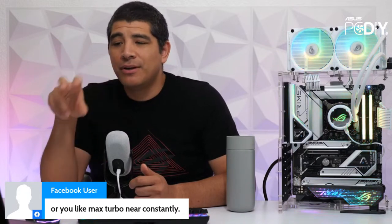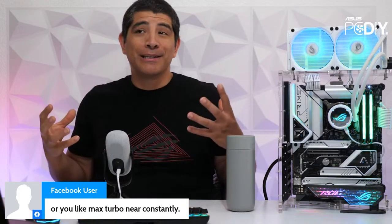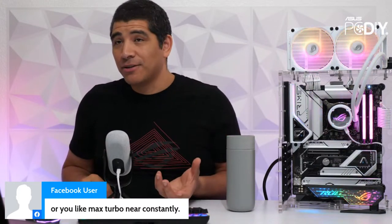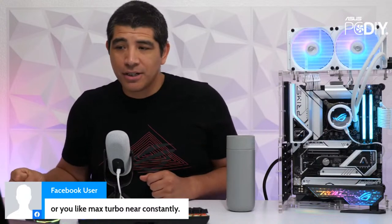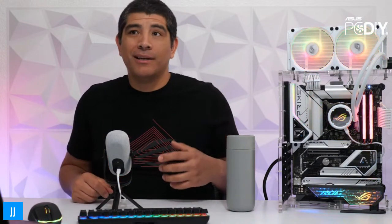So when you say something like max turbo constantly, what are you really talking about? Are you talking about with MCE turned off? Are you talking about with it turned on? And even when you talk about turbo, turbo is how you achieve overclocking, right? Because if you disable turbo, you can't actually have your overclock settings enabled. And when you're talking about max sustained, does that mean having all your P cores running at 5.8, which is not the way they would run? It would be much more conservative than that, right?